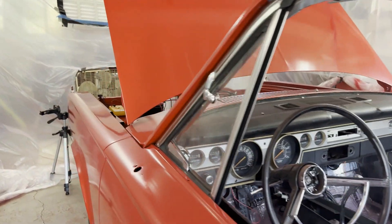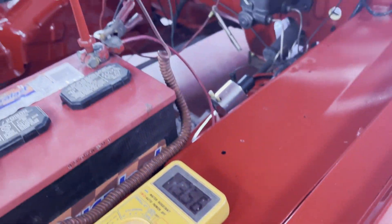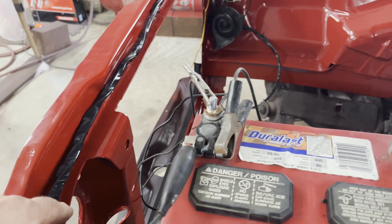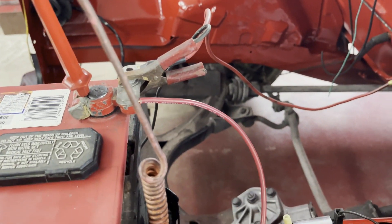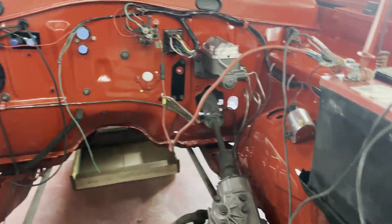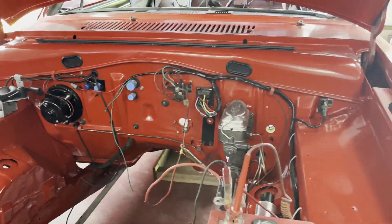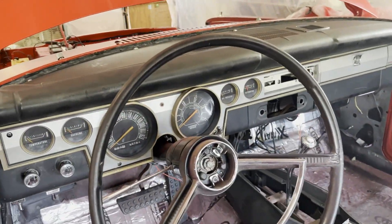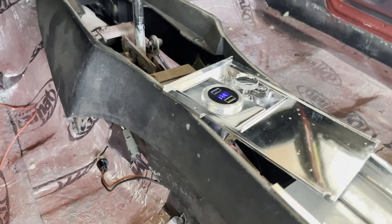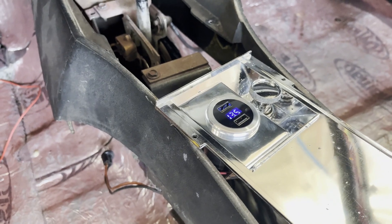Let me walk you through it. Okay, we've got the battery in. It's on the charger and we're pulling 13.5 volts. Got a temporary ground hooked up down here and temporary power to the starter relay there. This here actually powers the headlight relay box and fuses, which is down here, and looking good. Key is on right now, and I did add into the console a nice little USB charging unit for the phones and whatnot. Also tells you what the voltage is.